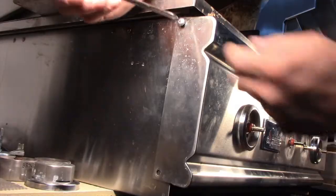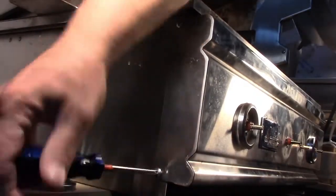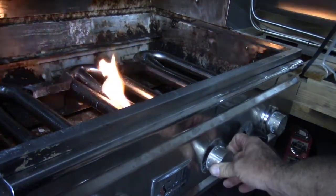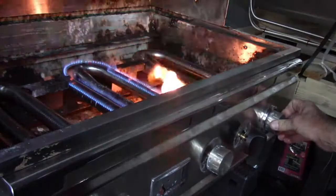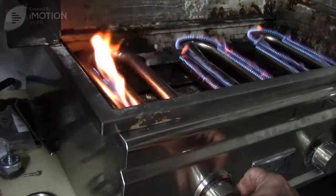Install the control valve panel assembly so gas orifices slide into burner opening. Air shutters can be adjusted after ignition. Once controls and orifices are verified and panel has been bolted in place, flamethrower valves automatically ignite when turned on. The rotisserie valve does not automatically ignite with the new valve, but barbecue burners pop and flare up to ignite burners every time turned on.